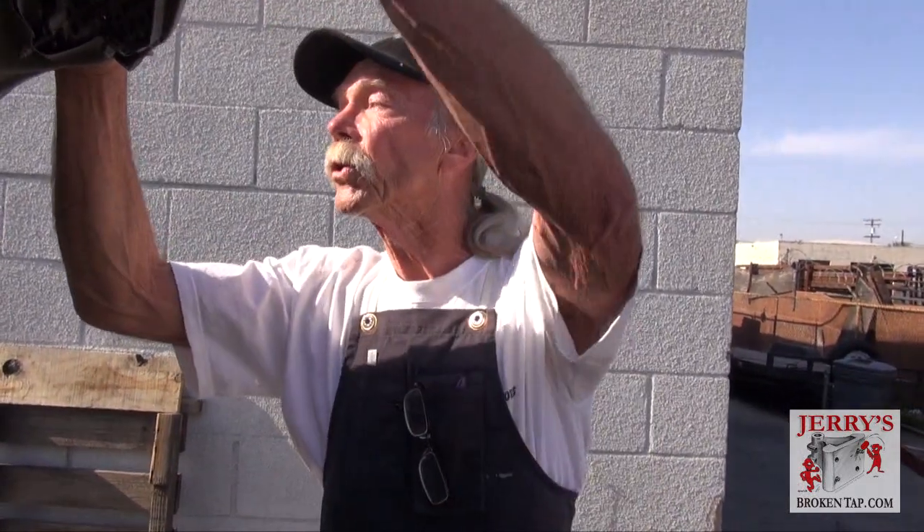What we have here is a Toyota that overheated and pulled the threads. The vehicle came in here to have us TimeSert it, which is the best fix that you can use. It's a very common problem. We have a Toyota here and we have a Toyota behind us, and they both came in for the same problem: pulled threads.